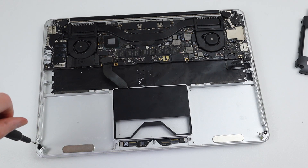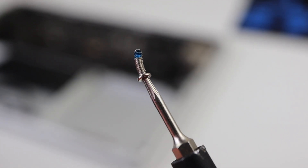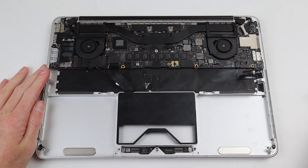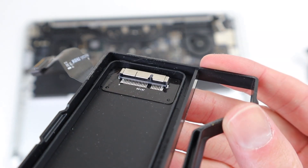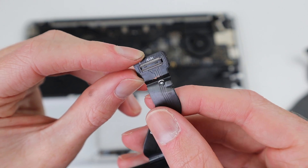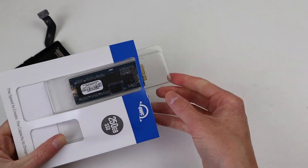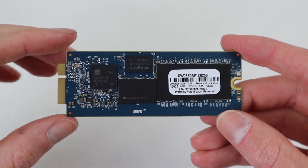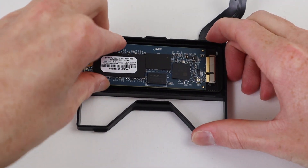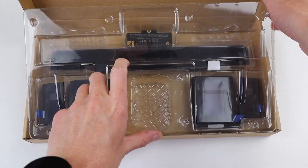I'll also take the time to remove the screws still remaining from where the speakers once were. You can see, given how bent they were, how much force someone put on these poor speakers trying to rip them out of place, not realising there was another screw in there. Removing the SSD caddy, you can see Apple's proprietary SSD connector, but this one also seems to have some slight damage to the cable, so I'm just going to swap it out. For our SSD, I'll be using this one from OWC, which is custom made to fit Apple's proprietary connector. I have gotten away with using an adapter with newer MacBooks to connect regular SSDs, so you might want to go that route as well.